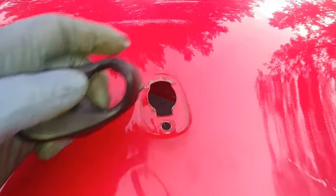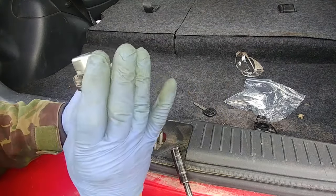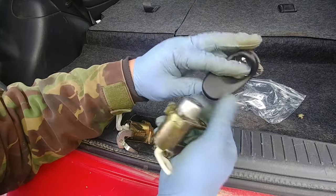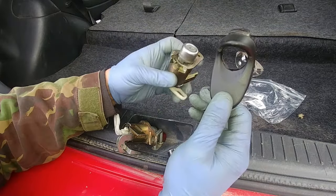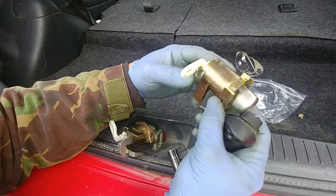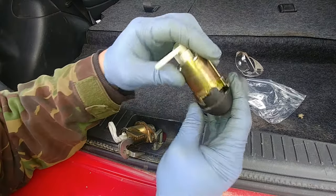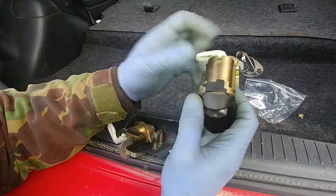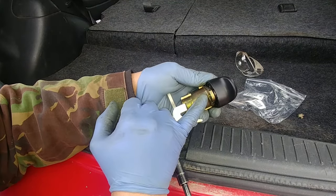Now we need to take off this plastic bracket. Assembly is simple and straightforward, but you need to pay attention to a few details. This is the outside bracket part — the plastic piece you'll see on your hatch door. The lock cylinder assembly has a sort of tab here, and you slide it in and turn clockwise — that gets it locked in place — then put in the one 10 millimeter bolt and keep it tight.